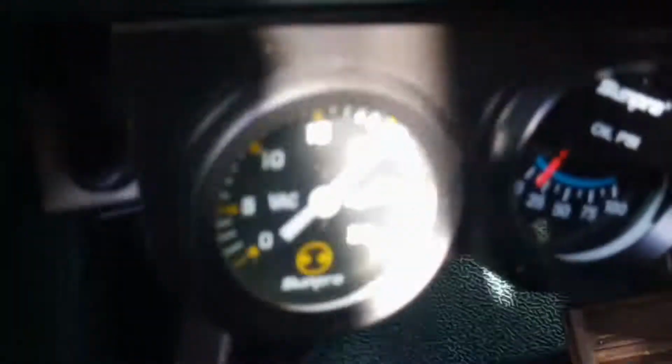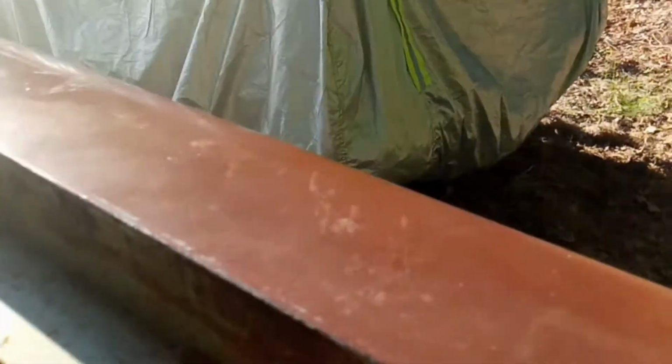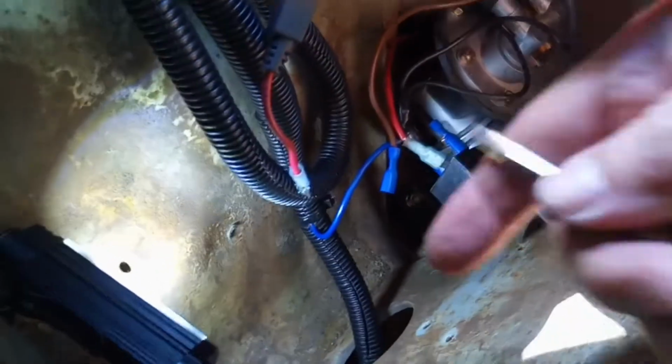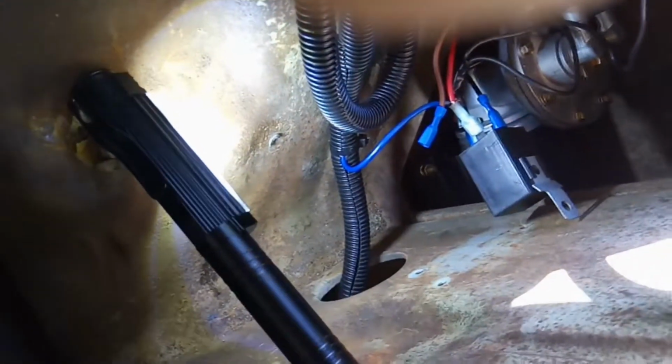All right, let's see where our vacuum is. Okay, we've got over 20 inches of mercury of vacuum pulled. And so now to test the switch, what you do is just take your test lead, and you can see the brown wire there. I've got to put my test lead on hot. You've got to have the test lead on hot to test the switch.